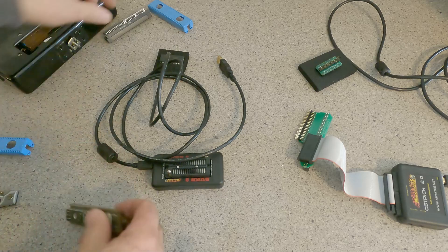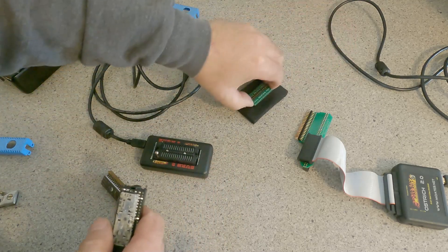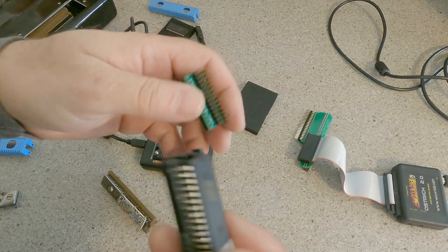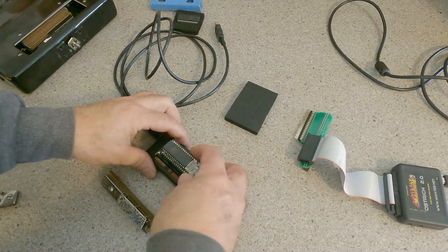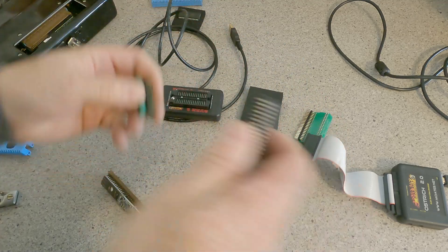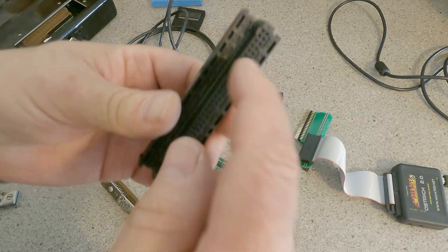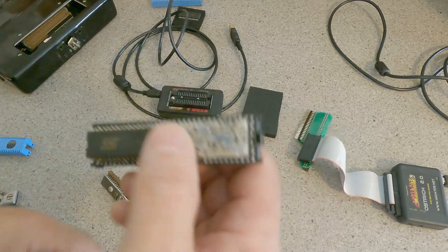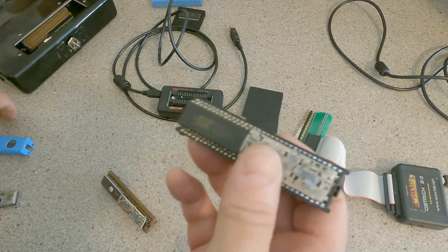If you have one of these modified memcals with the erasable chip soldered into it and you want to burn it, you'll also need this adapter. This one is from Motes — I'm not sure if BoostedNW has them, but I would think he does. You just pop it on there, make sure the pins are in the correct place, lock it in place, burn it, undo it, and pull it out. Every time you do that, all those pins are going in and out, and you end up wearing those pins out. Then your memcal or ECM, whichever part wore out on the pins, isn't going to work right.